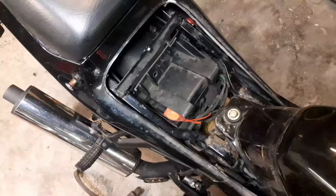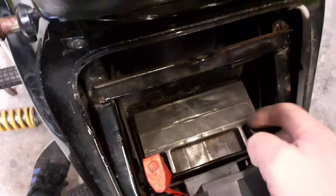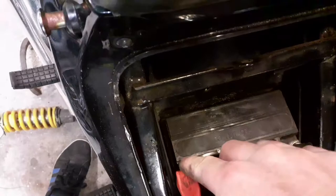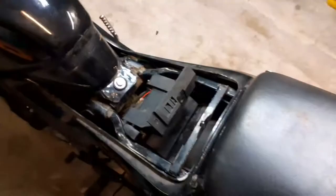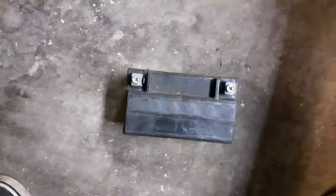To take the battery out, there's usually a little bolt in there, this one's missing, and this plastic just folds backwards, like so. You can then pull these covers back and remove them, and undo the bolts with a screwdriver. Not a very good cameraman. So I've undone them bolts, disconnected the wires, and the battery should just slide up out. This will be a little bit tricky in one hand. And out the battery comes.